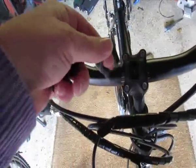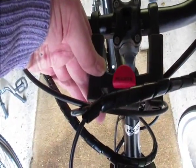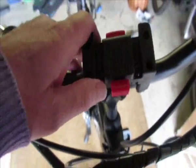We can now start and put it on the bike. We've got to put these brackets on — it's just a question of clipping them over here, one either side. Now we need to put the bracket in here and just line it up in the holders. The brackets are in, it's all loose, and now all we've got to do is put the screws in these four holes here.